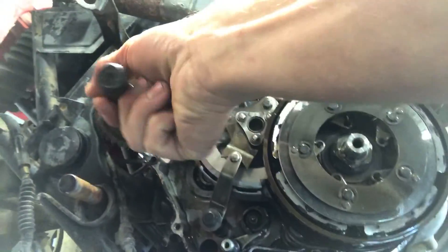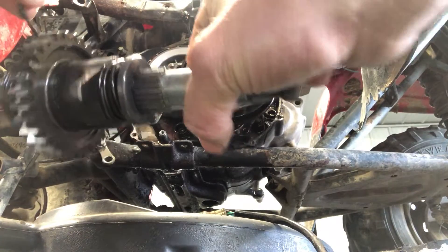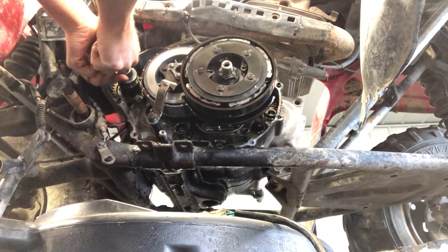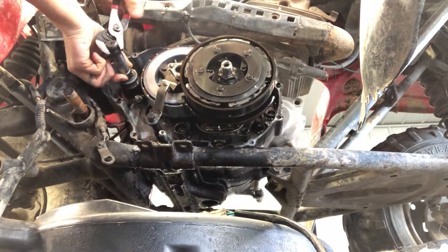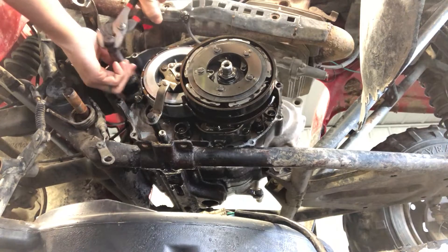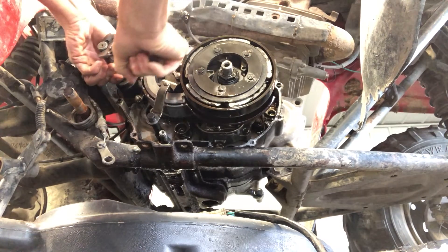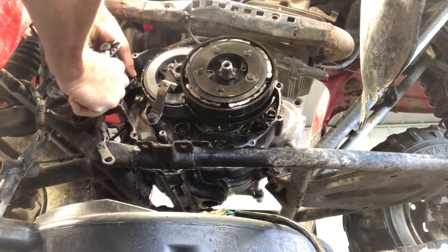The way you do that is put the hook that is on this spring into the hook on the case. So we're gonna slide it in there like that. Now before you take it too far, we're gonna take some pliers and turn this gear as far as we can. We want to make sure that the spring is hooked but the gear is still able to spin. We don't have it completely into that case yet — we're gonna hook it on to the kickstarter stop.